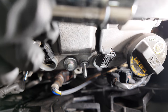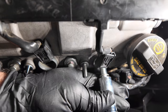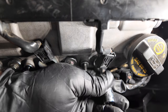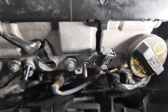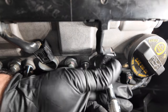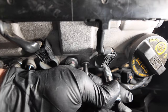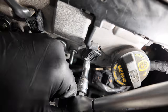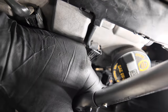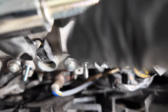As you insert the spark plug into the socket, make sure it is securely attached, either through the rubber or the magnet. This is important because if you drop it, it may affect the gap. Slowly lower it in and use your hands to start the thread. As mentioned before, the thread section is pretty lengthy, so be patient with this process. Once it's snug and you cannot move it with your fingers, torque it to 16 foot-pounds. Repeat this process two more times.